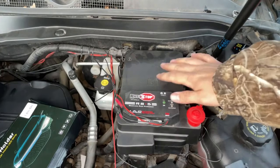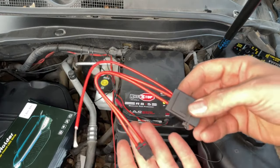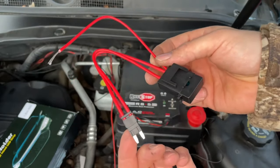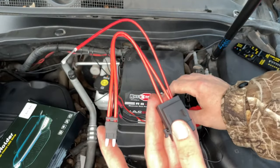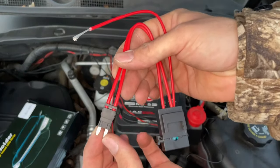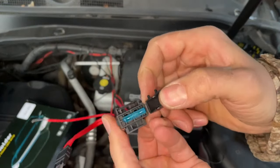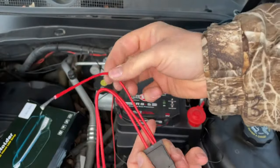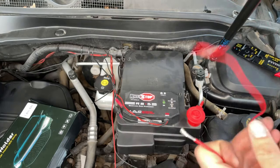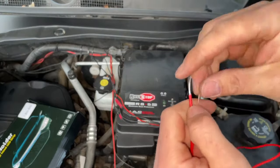I find this easiest to go into the fuse box because it's all under the hood — no messing around under the vehicle. To do this we're going to use a piggyback fuse, and I'll put a link in the description for this style. We're going to be taking out the fuse for our DRL or fog lights and replacing it into that location — it has a built-in 15 amp fuse. This third wire will then connect to our red wire that comes from our LED strip.